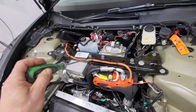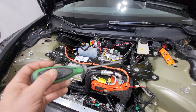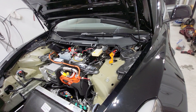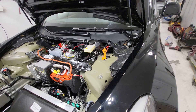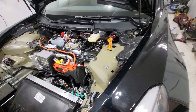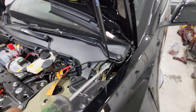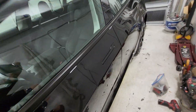This one just has two on the side so I went left and right, but if you have a front and rear they're going to chain together — super easy, same thing. Make sure you clean the undercarriage where you're going to stick the neons with rubbing alcohol on a rag, get them good and squeaky clean and grease-free so your neons will stick good. Now there is a red and black power wire inside the car.